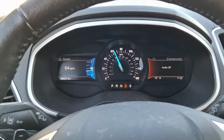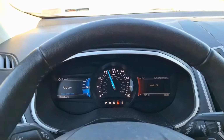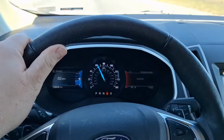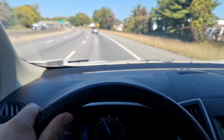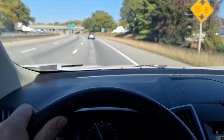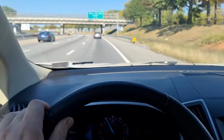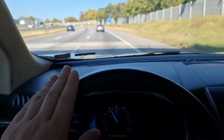Hold it there. Hold the accelerator down until you get about 70, then let go. Slow back down to about the speed limit. Repeat that 15 to 30 times. That is going to work the conditioner and friction modifier into the torque converter clutch really well, and force any remaining varnish deposits off the converter clutch as well. And anytime I've had torque converter shudder, even after a service, that's taking care of it.